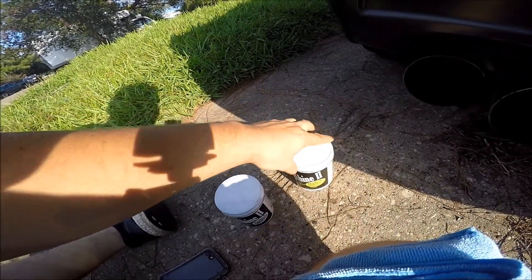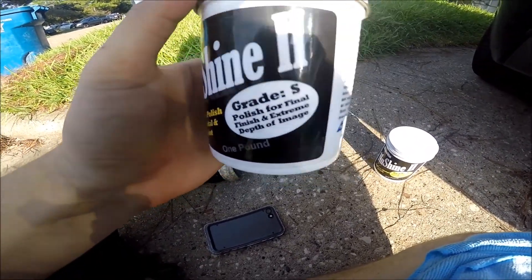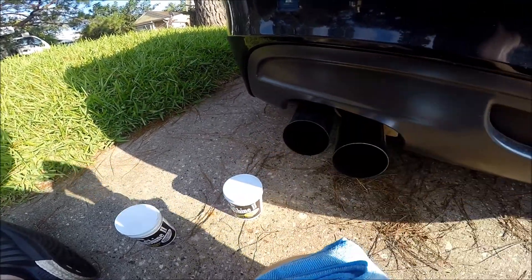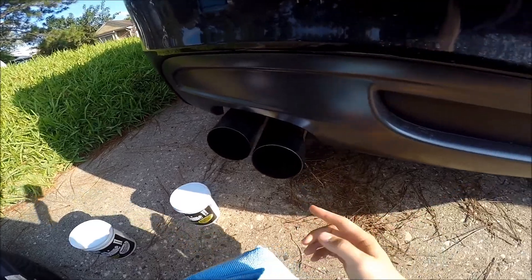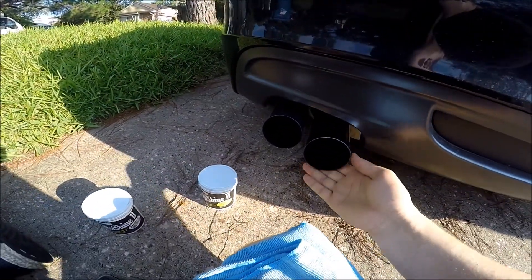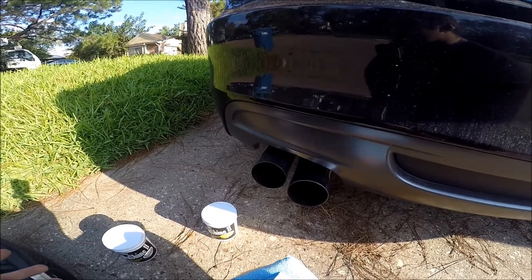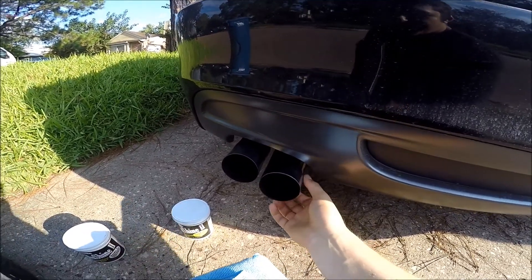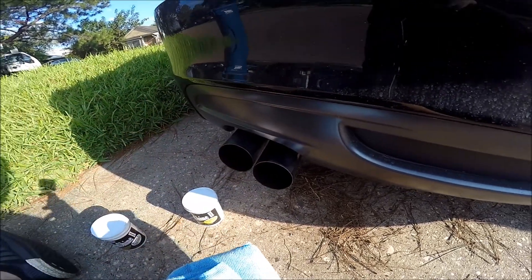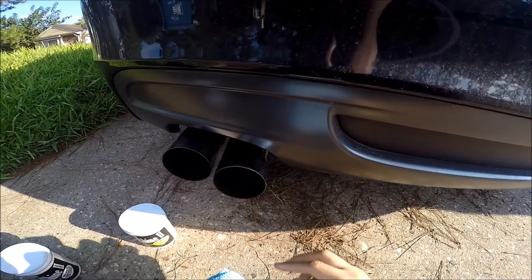Let's start with the types of polishes I use. I've got a compound here that specifies oxidation removal and repolish — it's aircraft grade, used for brightwork on planes. Then for my second finisher, it's a polish for the final finish and extreme depth of image. It really gets rid of fine swirls and scratches that the compound might leave, and in my experience it's perfect for this oxidation.